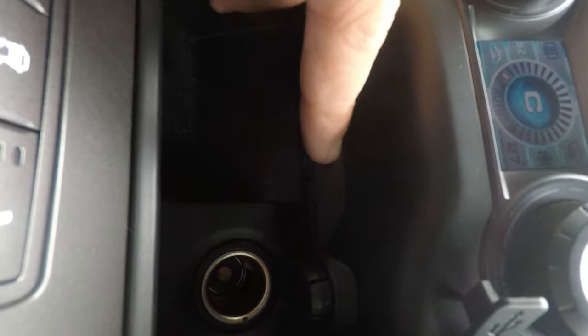It's dark down there. I'm not 100% that you guys can see it. Is that there's a screw right here. And basically, you have to drill into the plastic that's back there so that the fascia is secured at the bottom. Good idea. I don't mind drilling the hole. The only issue is it's very difficult to get to. I tried moving the shifter all the way out of the way, over into sport, all the way over into downshift, and I could not fit a normal drill in there properly, and as a result I actually damaged the hole there a bit.